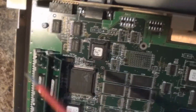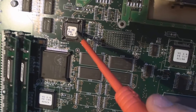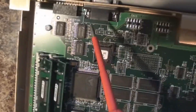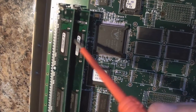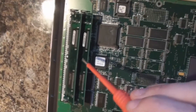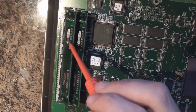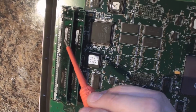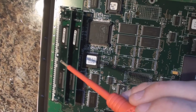Now we've got a series of basic RS-232 controllers here. We've got what looks like a small BIOS chip, which may be to hold the flash data for the RS-232 menus. As we move across here, we can see we've got two strips of memory, which on this sticker look like 32 megs each. Now, they're standard 72-pin SIMMs, which are very obsolete — they would have been almost obsolete when this was made. But because of the application — it's only a hardware firewall in effect — as long as it worked, speed was not really an issue.